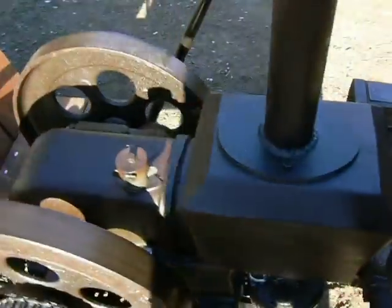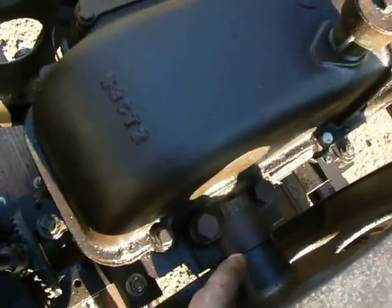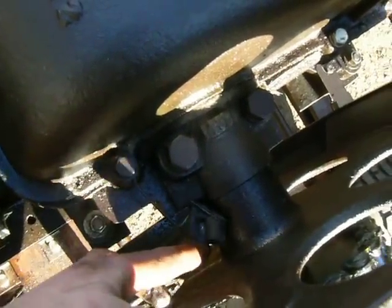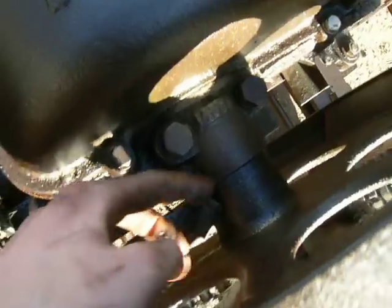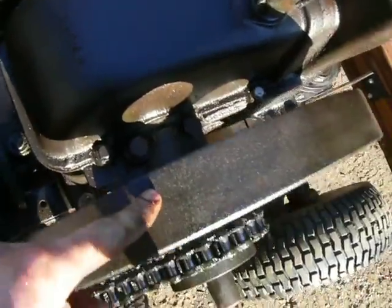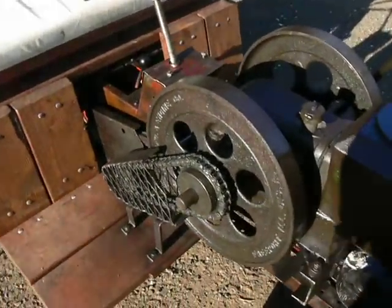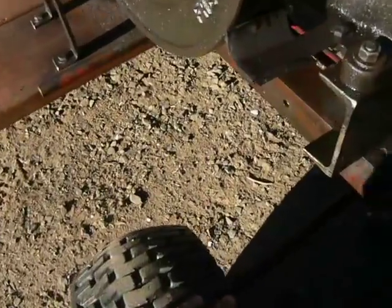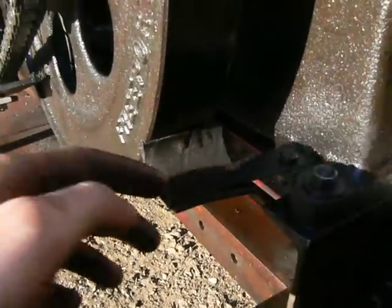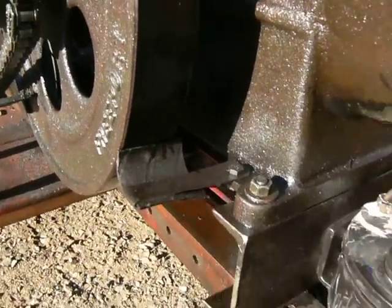CT2s are apparently notorious for leaking a lot of oil where the crankshaft comes out of the crankcase. So I made these little wipers out of heavy fabric and a piece of wire that catches most of the oil. The remainder makes it out to the rim of the flywheel before it gets slung off by centrifugal force onto the passengers. I also made these little squeegees from inner tube rubber and a small piece of sheet metal, and they seem to work pretty well.